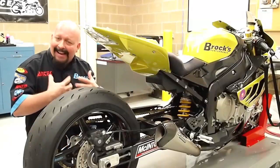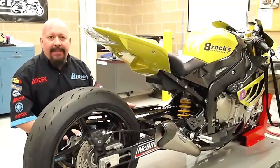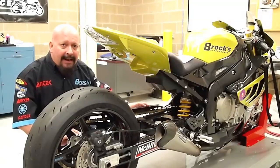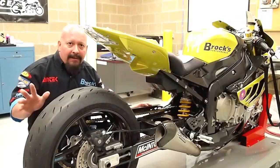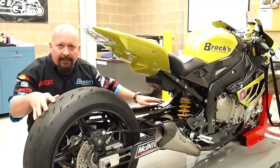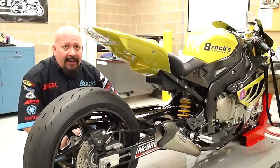With myself on board at 200 pounds in my shorts, my best pass is an 8.75. You would think that with the difference in weight — Jeremy is quite a bit lighter than I am — that we might have to do a whole lot of changing in our suspension back and forth. The reality is, if the track conditions are good, we really only do some tire pressure changes between he and I. If the track is real slippery, we'll make some minor suspension changes, but really, this bike is so fine-tuned after a year of back and forth that we don't have to do a whole lot of changes.